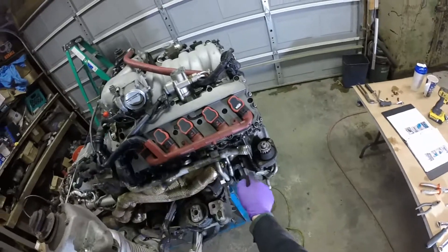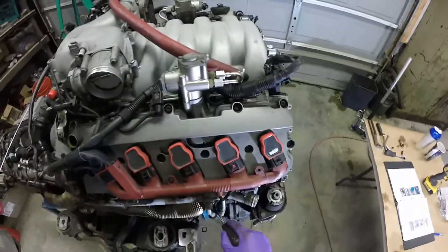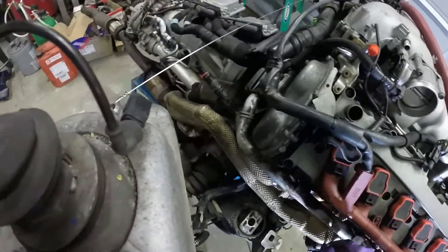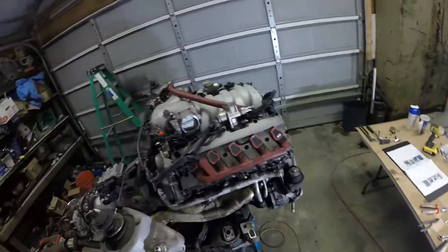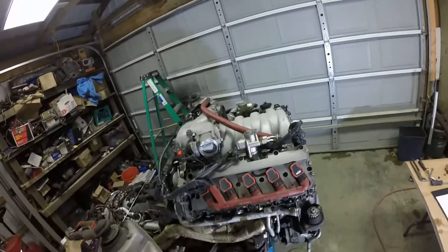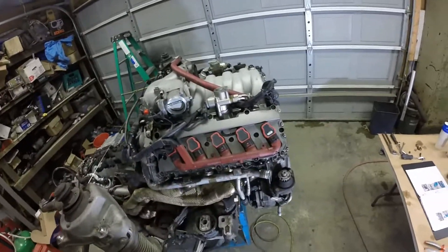This goes to the engine oil cooler. The trans oil cooler is underneath between the subframe, and the engine oil cooler is here. Someone on Audi World was also experiencing coolant loss - Blackstone Labs did a test and determined there was less than 10% coolant in the oil, but no milkshake or contamination was noticed. Since I also have disappearing coolant with no other traces, I might want to pull the engine oil cooler off and pressure test it. I'll check the trans cooler as well - the fluid looked completely normal red.